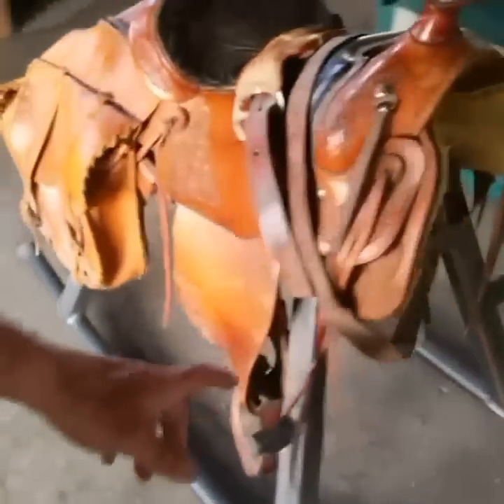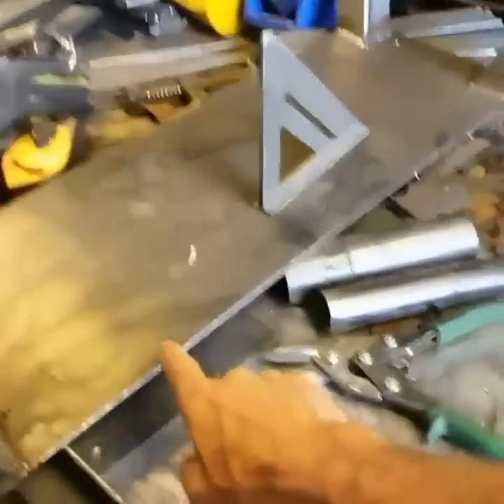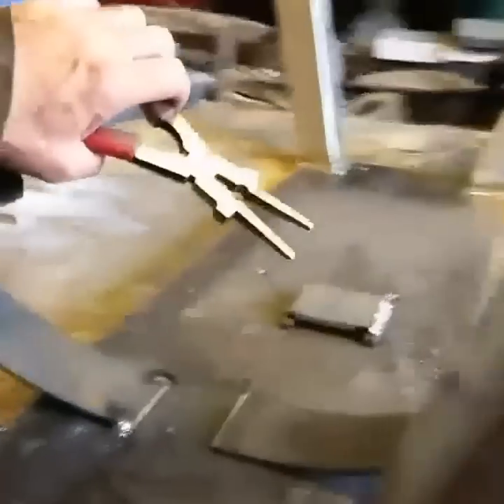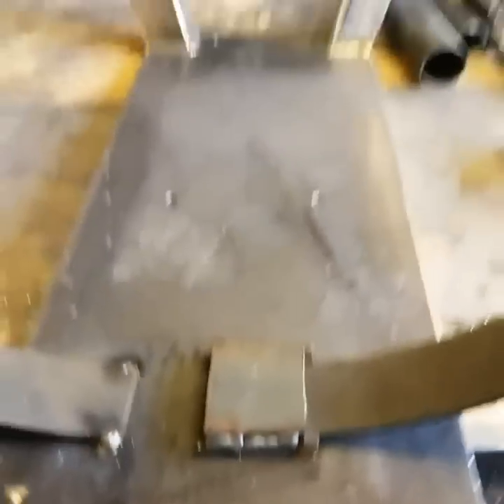We just need to come up with a hoop down here where it'll fasten. I've already taken the time to get this hoop made up — it's made out of two-inch by three-sixteenths strap. We're just gonna take a minute to figure out where we're gonna cut it and then weld it in place right here where it'll flex. I may just figure out a way to weld it right here and then put a collar over this so it'll flex in and out. We got this little deal set up here — it's hot right now but it's gonna weld down over this, and then this will be able to hinge. We'll dry fit it before we finish welding it and take it to paint.